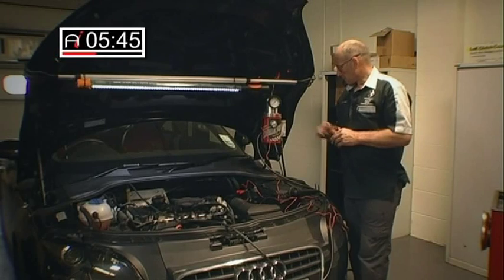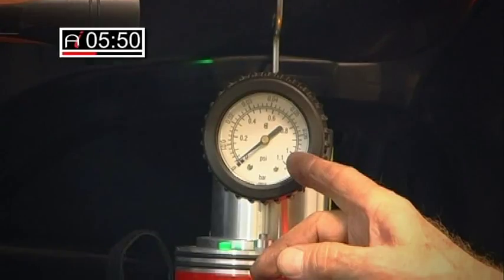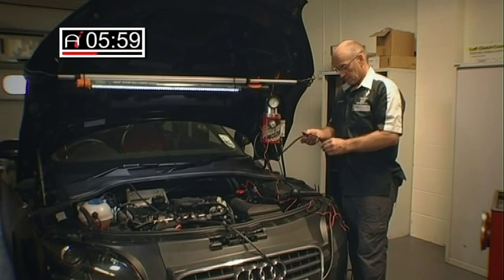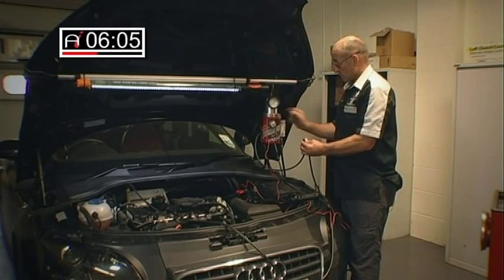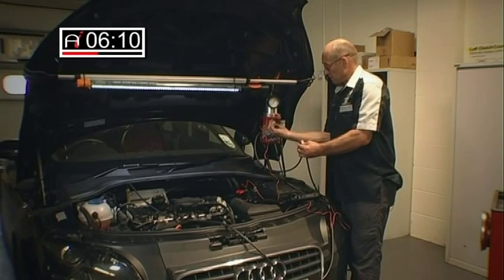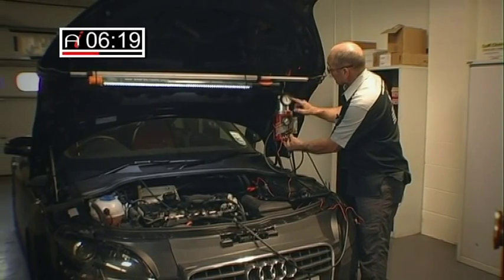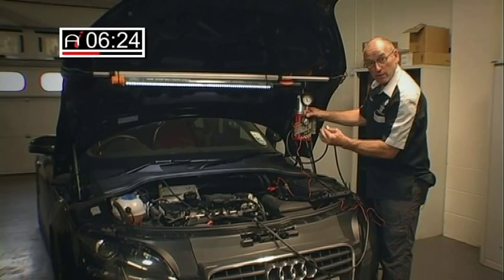Back to the machine — the oil is now quite warm. We have a gauge which measures pressure, and the first thing we want to do is check the accuracy of the device itself: a proof test. Simply clamp the pipe, re-engage the heater, turn the volume valve fully on — pressure has risen. And if we take a reading, it's just under 0.5 psi with zero leakage.